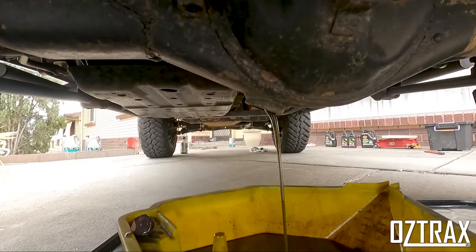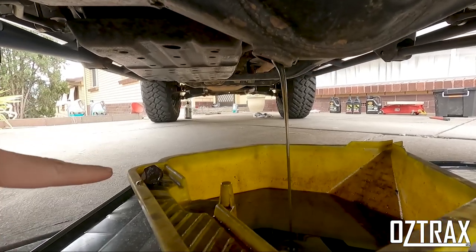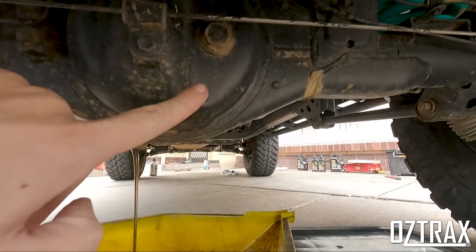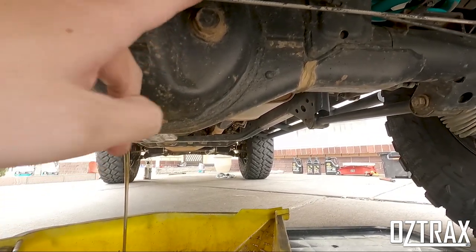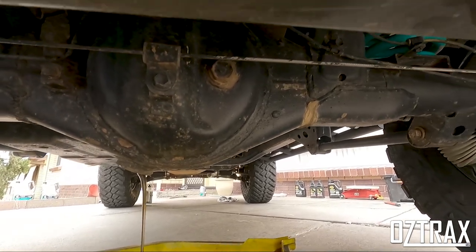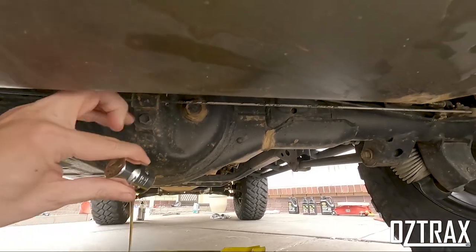Back from some lunch. I'm just going to do a quick visual inspection on the front end here, make sure none of the drain plugs are leaking. Then we're going to make our way up to the back of the car and change the rear diff oil. Once you've cracked it, drain plug's just there draining out, your fill plug is just up here. You'll probably need a spanner on that because your handbrake cable's in the way.